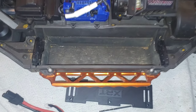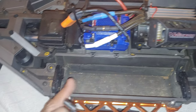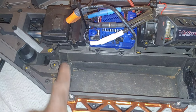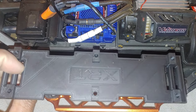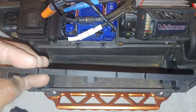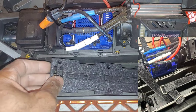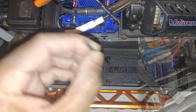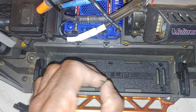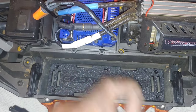To get the stock battery tray flipped out, it's just two screws underneath the chassis — unscrew them and pull them right out. After that, the XRT plate is going to be facing down because it sits up just a little bit. When you put your velcro straps on, you'll have a little wiggle room. Place the tray in before putting the straps on. Remember: safety first — wear your safety goggles — and go ahead and drill those six holes.